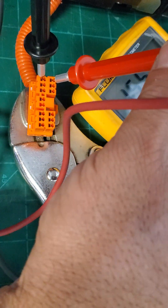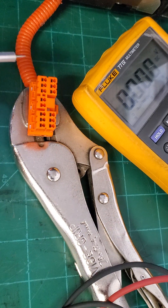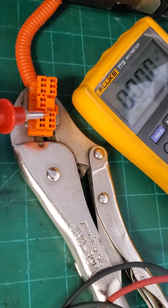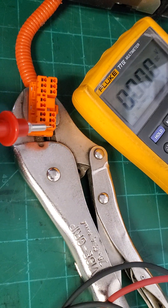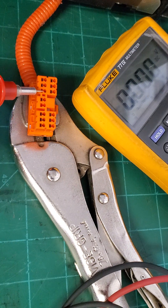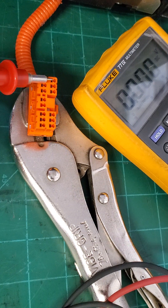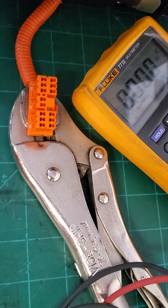Once again, this is just for informational purposes. Here's the pin layout again: pin 1 is your main ground or main negative, then pin 2, pin 3, pin 4, pin 5, pin 6A — one side of the safety disconnect switch — pin 6B the other side, then pins 7, 8, 9, 10, 11, and pin 12 which is your main high voltage positive. If anybody has questions, comments, or concerns, don't hesitate to let me know, and don't forget to subscribe.